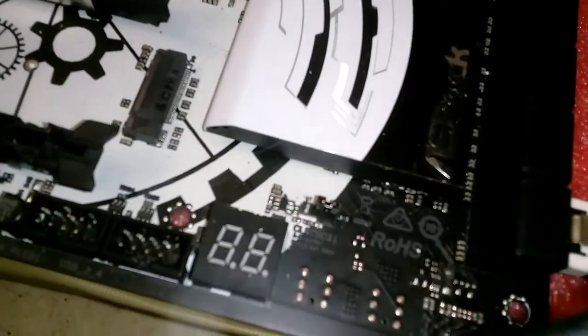I just flashed the BIOS and I rebooted. I cleared the CMOS, which there's the CMOS cleared right now. CMOS jumper is cleared. See it? It's on the clear position. So, new BIOS is in. We're going to see if I'm right. Without even having flashed to this BIOS, I'm going to tell you it's gonna bug. Never used it before, but I know it's gonna bug.